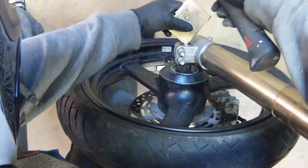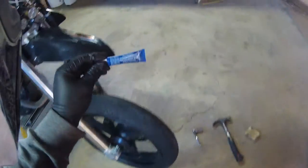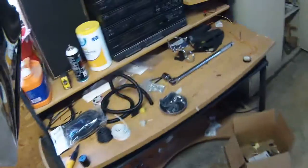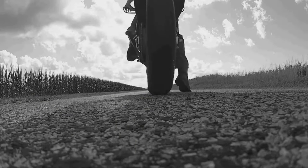For these axles, what I use is a hammer and a little block of wood. That allows you to tap it in there nice and neatly without breaking anything, since it's a soft piece of wood. Once you do that, you're going to want some thread locker — I've got medium strength here. Put thread locker on there, grab your washer and nut, place it on there, screw it down with your fingers first, then take your torque wrench and torque it down to Suzuki spec. And voilà, your front is done.